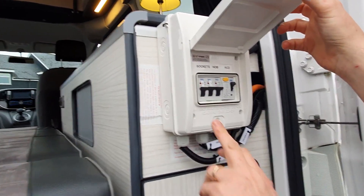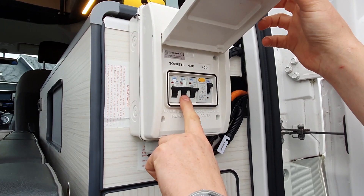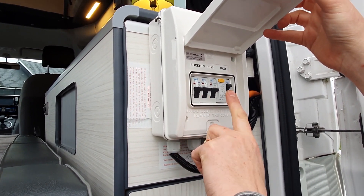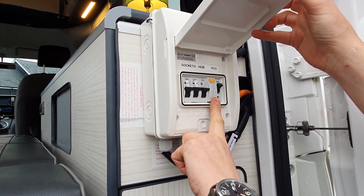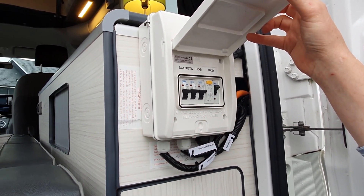Normally if you try to do that with standard lead acid batteries, you'd end up with probably 200 or 300 kilos of weight. This thing comes in at under 70 kilos, and you've got all that flexible power and the ability to charge it quickly, either from solar or campsite. What we've got in this consumer box here is your standard domestic electrics - sockets and hob - with RCD protection, so everything is safe on board. If there were a fault anywhere, it just trips out, much like your house.